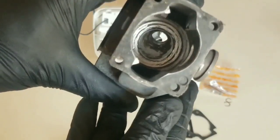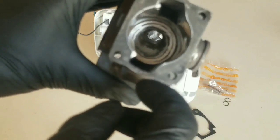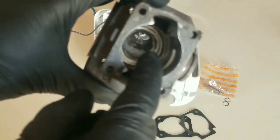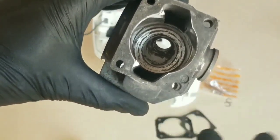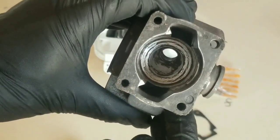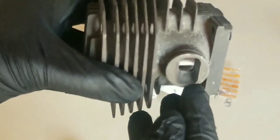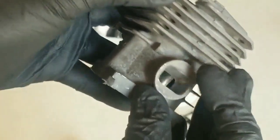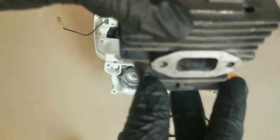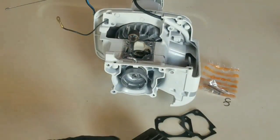Now when we take a look inside of the cylinder head, you can see we went in there with 200 grit sandpaper on a power wheel and cleaned up inside the combustion chamber. This is going to reduce the likelihood of carbon building up in there, like I said before. We have a picture here you can look at to see what it looked like before it was detailed. Now you also want to do the same thing at the ports. You just want to smooth it and get all the grit out of the surface, because the grit is what's going to hold carbon and oil sludge, causing a blockage later on as the engine endures. So that is very important to consider when assembling the piston into the cylinder.